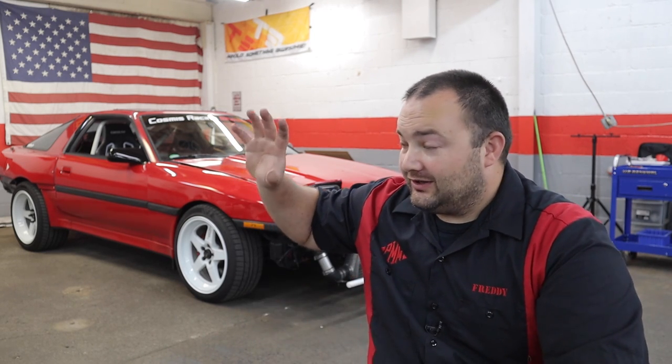I'm pleased with that, especially for the price. Now after lifting the rear and all the Techno Toy Tuning arms I did, I can finally get this thing aligned for the drive out to Las Vegas. But there's more things I want to do — I want to put a better alternator in this. I recently did an upgraded head unit and put a subwoofer in, and I have a Walbro 440 fuel pump, electric fans, and with the blower going it's a pretty big draw. The stock alternator in these is only like 80 or 90 amps and that's just not cutting it.